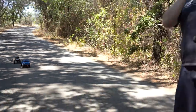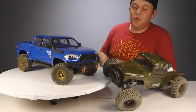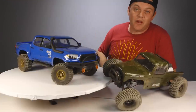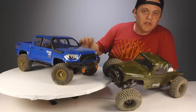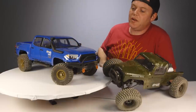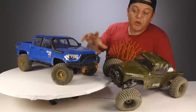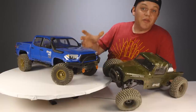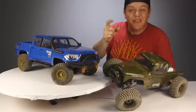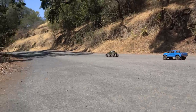They're pretty dang even. Both trucks have a pretty tight turning radius regardless of tire size, and they both had overdrive engaged. It was about 105 degrees out there, but the trucks did really well. The Nightrunner performed better on those rocks than expected. The smaller tire size does lead to a little less ground clearance for the axle, and the IFS skid plate gets hung up on rocks quite a bit, as do the front and rear bumpers, so you have to be more careful picking your lines. It was more challenging to drive the Nightrunner than the Ecto — those big tires feel like cheating after driving this truck. The smaller tire size also leads to smoother throttle control on the low end but less top speed versus the Ecto, since they have the same gearing with just different tire sizes.